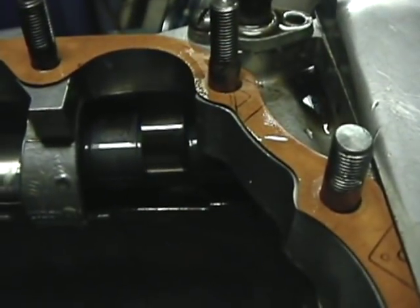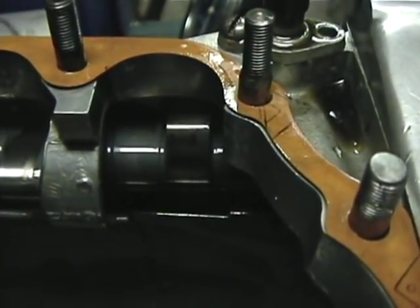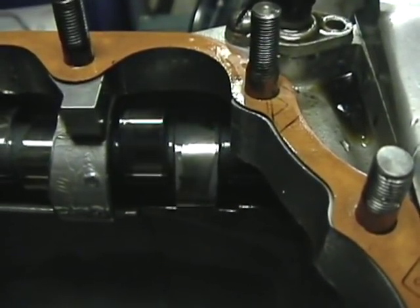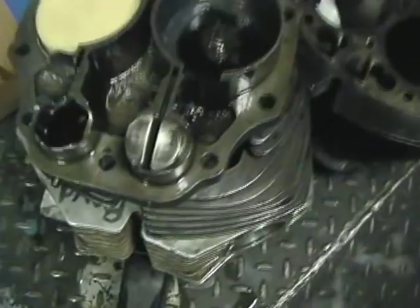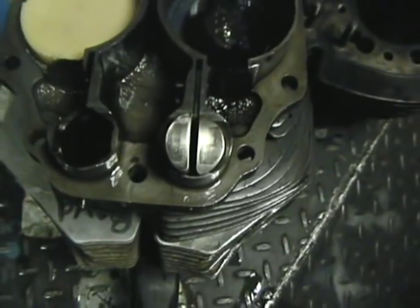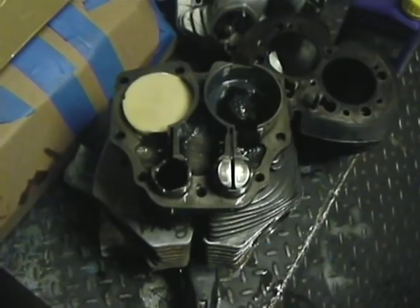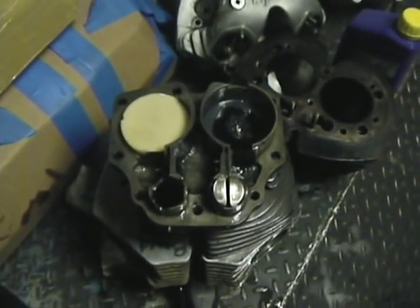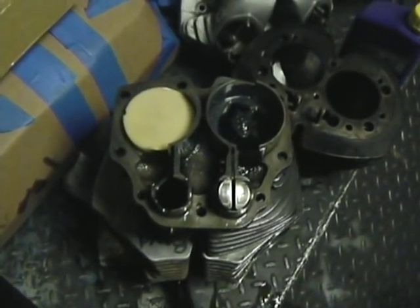Here's one more look. We're running one more hour at 5,000 RPM this time, and everything is looking very good. Not seeing any signs of problems on the lifters. So tomorrow I'll probably get a little more serious and just basically let it run at 4,500 or 5,000 RPM for probably an 8 to 10 hour day.